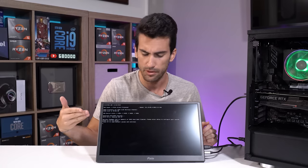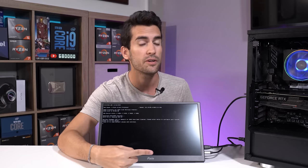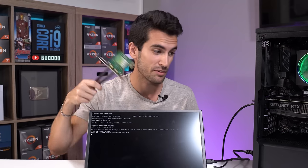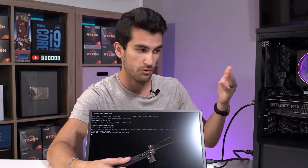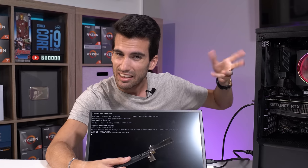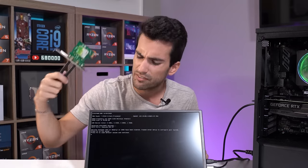Now, at this point — mission accomplished, right? We got a post, we fixed the issue. But I want to take just a few more minutes to further investigate what exactly was causing the no picture issue. I have a feeling that if it's happened to this viewer, it could happen to some of you. So I've got my own Wi-Fi card here. We're going to connect this to this viewer's build and attempt to replicate the no picture issue. I have a good feeling that since all we did by resetting the CMOS was reset BIOS settings, there was some setting enabled in the BIOS by default when he connected his Wi-Fi card, and when he removed it, that setting remained and possibly prevented his card from functioning the way it should. Maybe there was some setting that was turned on when this was connected — I'm going to see if we can notice a difference in the BIOS.